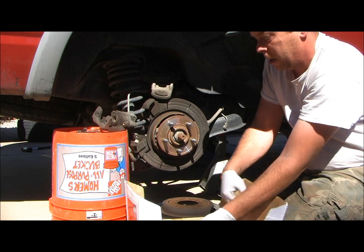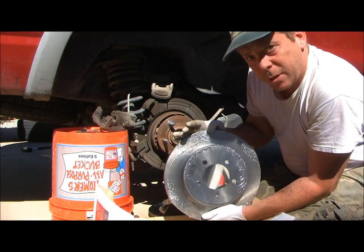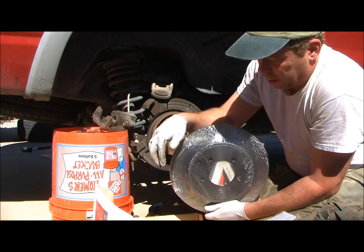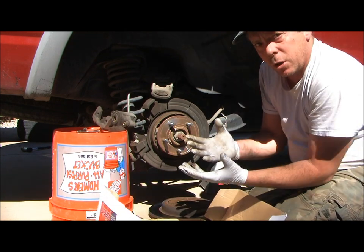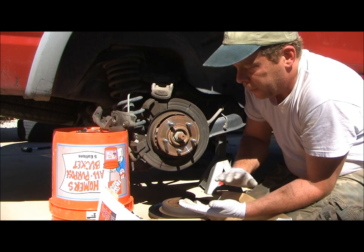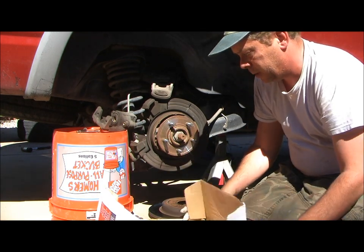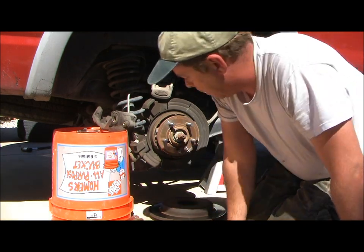Here we've got the rear rotor all wrapped up. When these are shipped from the factory, they coat them with a fine layer of oil. They do this to keep the rotor from rusting in transit — you can see there's a little bit at the bottom there. So when you go to put a new rotor on, what you need to do is take a rag or a shop towel and some brake cleaner, spray it on the rotor, and clean off the surface. Because if you don't do that, it will be on the rotor and you won't be able to stop effectively. So you get that all cleaned off, and then we'll proceed with the reassembly.